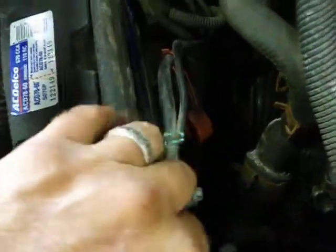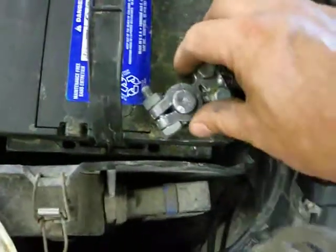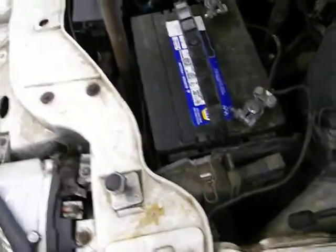One of the things I want to point out is if you look at this battery, look at all the green corrosion on here and all the rust on the terminal for the negative terminal — that should all be cleaned before we even attempt to start this, because that alone is going to create a lot of resistance. The connections also can't be loose like this, because that creates a very poor connection with high resistance, which prevents proper current flow from the battery down to the starter motor to actually crank the engine over.